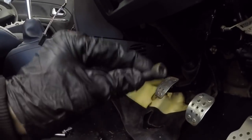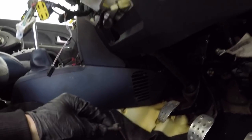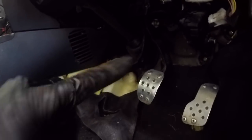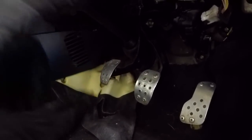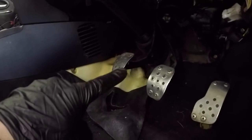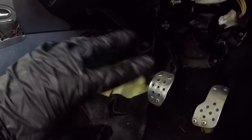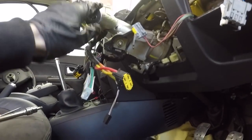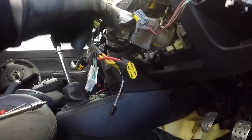Make sure it's tight, make sure it's in the right place, because this is your life at the end of the day, so you need to make sure everything's right when you put it back in. We put the end through, and I've connected it onto the car with a 13. I haven't pushed the rubbers through yet, and I haven't tightened it, just in case it has to move around a little bit. And I'm going to tighten that up now, get that on, tighten it up, place this into place, then slide the motor on and put the 2 bolts back in.